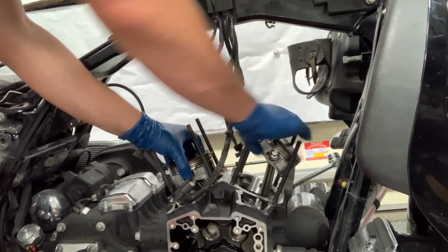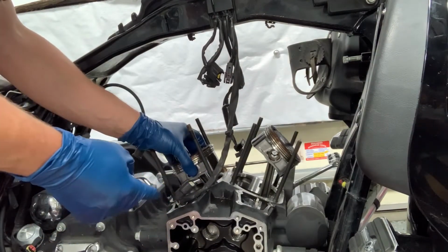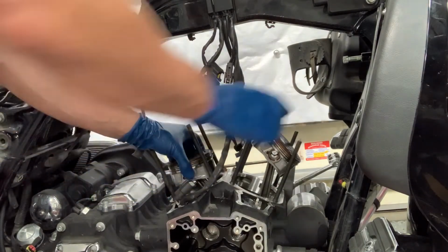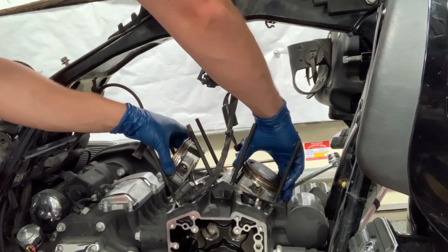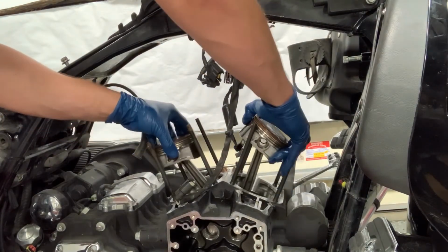You have to do this a bunch of times because since these are roller bearings, every time that you stop, the rollers are going to end up in a different position. So you don't just do it at one spot. The rollers could have flat spots somewhere, and if you don't try this in a bunch of positions, you might be missing where you've got a wear spot.